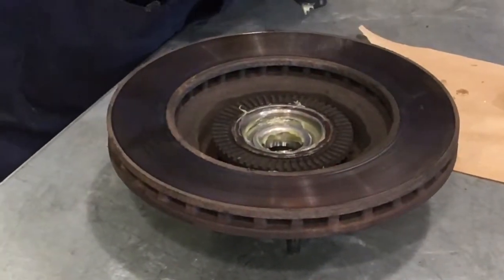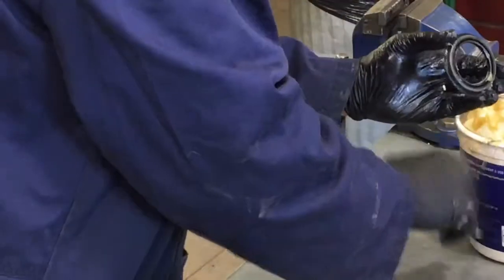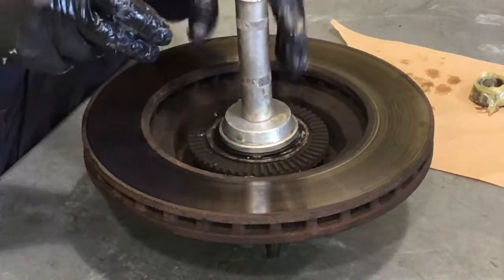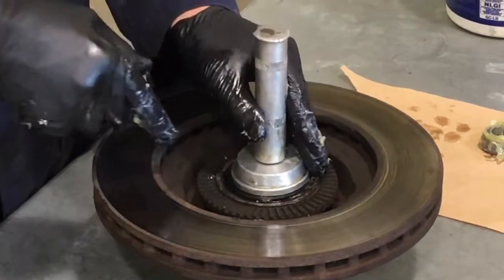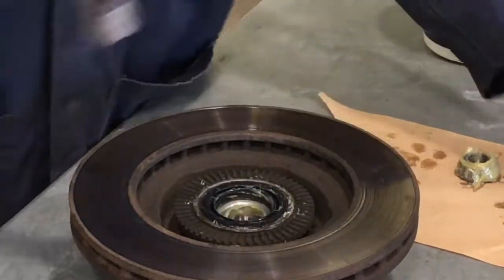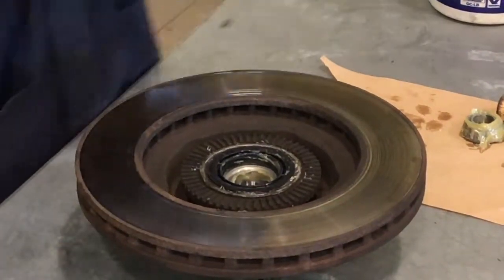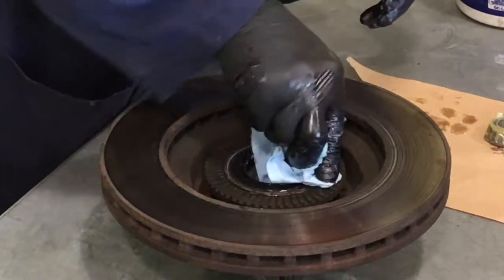Now I'm going to take the seal. One important thing: seals have to have grease too, so grease that seal up on the inside and take the excess away. I'm not greasing the outside of the seal. I'm going to grab a hammer and a seal installer, put it on the seal, and tap it back in. Some people install it with a hammer by being careful on the perimeter, but never strike on the inner area where the seal lips are because you'll damage the seal. Gently tap it down and make sure that seal is nicely set into its bore. Then take a rag and clean up anything that could centrifugally fly out and go into the braking area — wipe off the outer perimeter of the seal, not the inner seal lip area, to prevent brake contamination. Be really careful when installing seals not to strike the little tooth ring around the outside, as that will impact how the ABS system works.